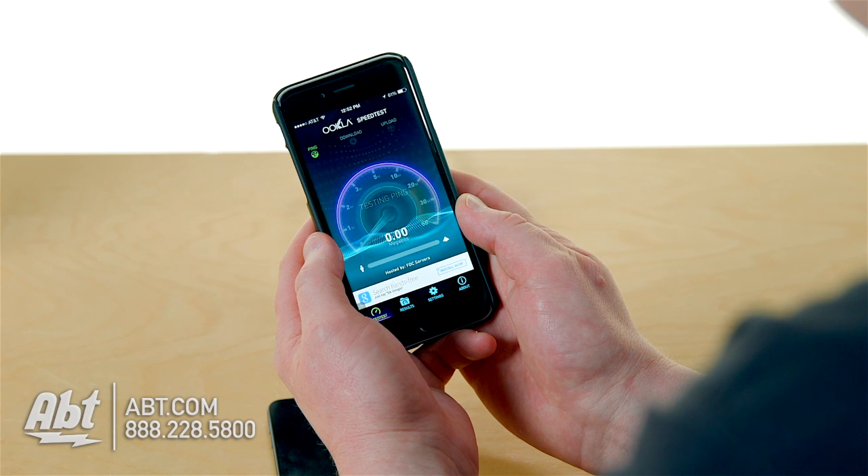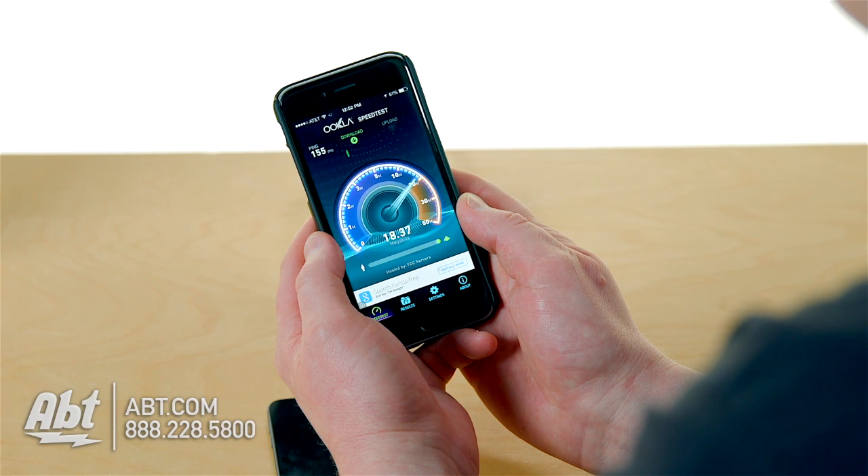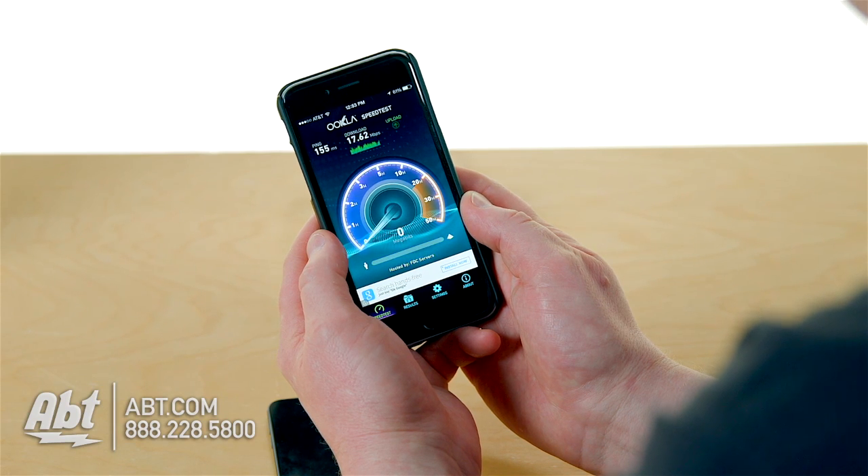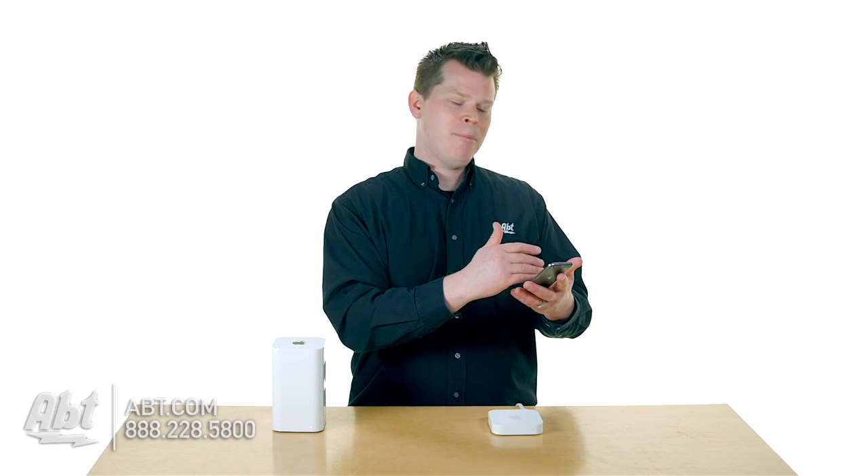How do you do it? I'll show you an app on an iPod, iPhone, or Android phone — open it up and run a speed test. Do it next to your main router to get a feel for the maximum Wi-Fi bandwidth; the speed test shows you in megabits per second. Then walk to the spot that's horrible in your house. You'll probably see you went from 20 megabits per second downstairs to 0.02 upstairs. The goal: find the location between the bad spot and your main router that still has a really good signal.